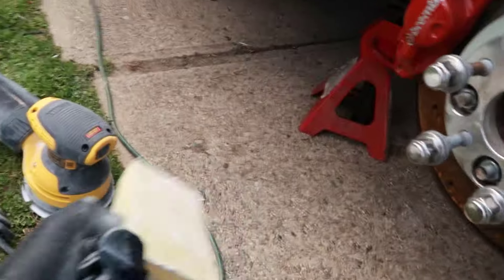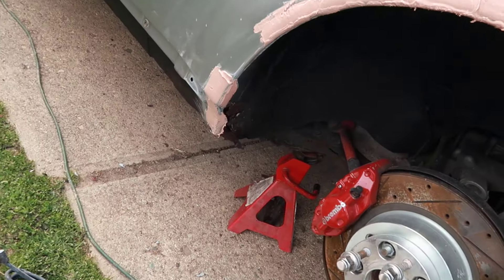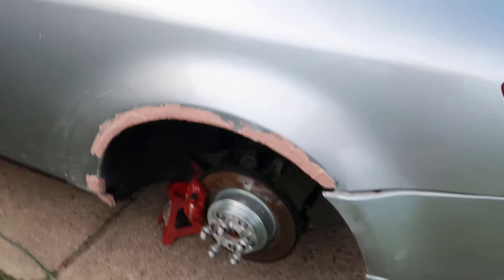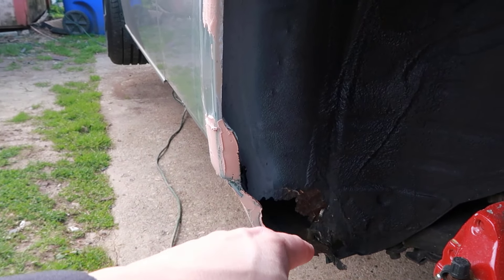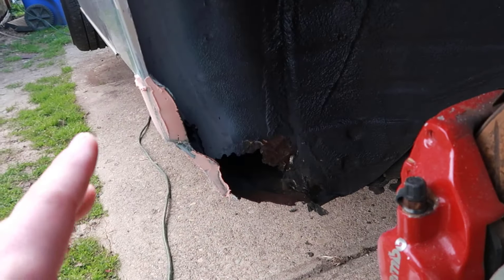So I used the 220 grit on the orbital sander. I wasn't planning on getting it all down because I had to put another coat of bondo — it was just a little more helpful than doing it by hand. Now I'm going to go ahead and clean it and then put the other stuff on there and wait for it to dry and then sand it some more. Now I'll just put some more filler on there and wait for it to get hard and then go ahead and sand it down again. Hopefully this side's quicker. I did buy some sheet metal — I'll probably cut it off somewhere around there and put it on, because I didn't really want to have to mess with filling that thing up with bondo.